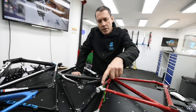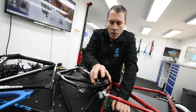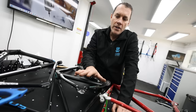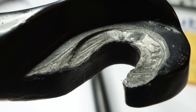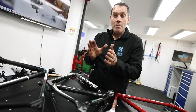This is an alloy dropout — yes it's heavier, but it's replaceable. You've got the hanger and dropout all in one. We moved from a pure aluminium dropout into an aluminium-inserted dropout in a more modern style where it attaches a hanger. The benefit of an aluminium dropout is it abrades much slower — you can see this one has had a good life but is still in really healthy condition. Then they went to this carbon iteration, which I really don't like. You can already see on this particular bike how much the inner slot wears out, particularly on the drive side. You can ruin a carbon dropout with a loose gear in one ride.